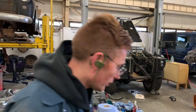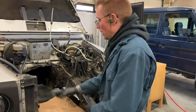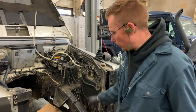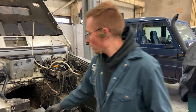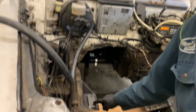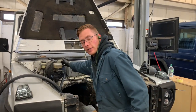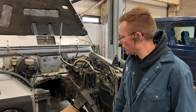If you're doing a right-hand drive one, you'll have noticed the two things that I've done. On the right-hand drive one, I've taken the power steering pipes off. The reason for that is it doesn't give room for the fan. So I just replaced those with a flexible braided stainless hose and P-clipped them to the frame. And the other thing that I've done, because this is a right-hand drive one, is a spacer on the mount. That's a 12mm spacer. The reason for that is because the back of the head here on the 606, with it being quite wide, gets quite close to this master cylinder. You won't have to worry about that if it's left-hand drive, but that's all it takes just to make it work. Everything else is original factory Mercedes.